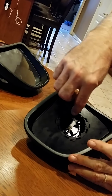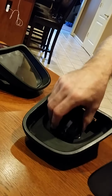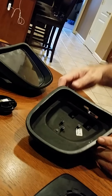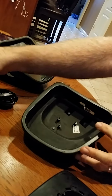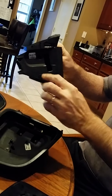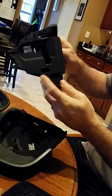Take out the 3 screws that mount the swivel mount. Pull out the swivel mount. You get access to the screws that are in this piece. Take out those screws, 1 more screw here. Pull the pieces apart. You'll end up with this free. This is the piece, $94 from BMW, that holds the clips that snap the mirror onto the side.